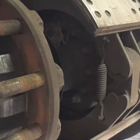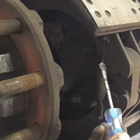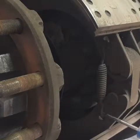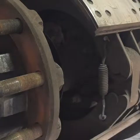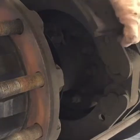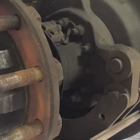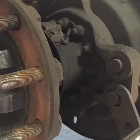On the other side, I didn't show you guys how I take these apart — it's super easy. This spring here, you have one just like it on the other side. What I do is just stick a screwdriver right behind the ear and just pop it out. I do the same for the rear — just pop it out. Once you got the springs removed, the brakes come off real easy, sometimes a little stubborn, a little stuck. What I do is I always pull the upper one off, twist, pry off the S-cam, and the rest of it comes right off.